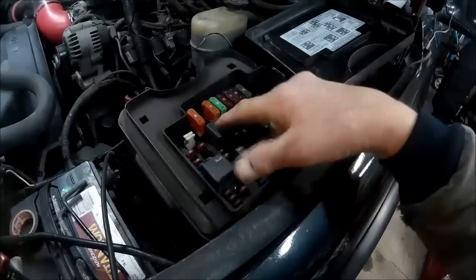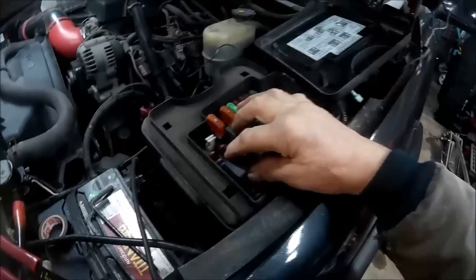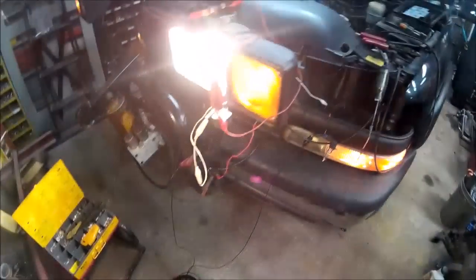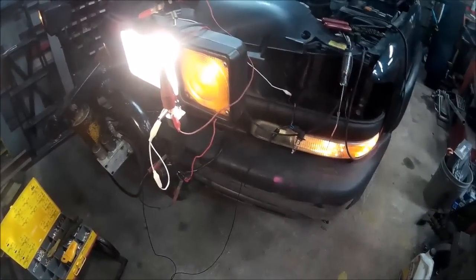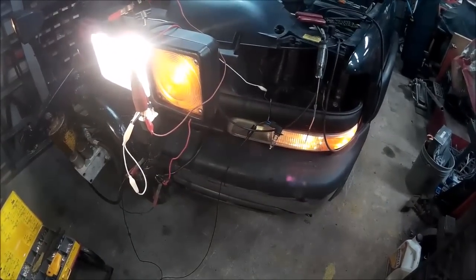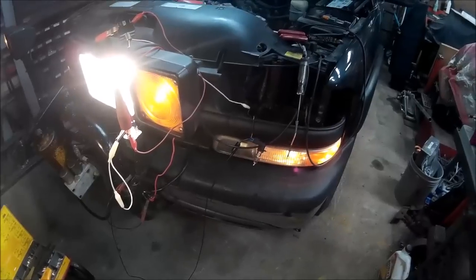These are those relays right there. There's three of them, and so these relays, I can pull one out of, say, a junk vehicle and just plug it into here, and I'll have the relay. So they're easy to get. You don't have to buy an aftermarket relay. They're plenty heavy enough. They're made for this type of situation. So there it is. We'll get to wiring this up and show you the end results.